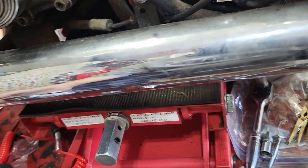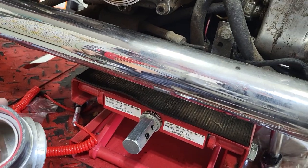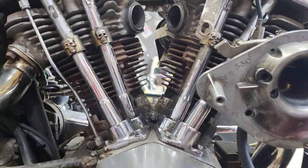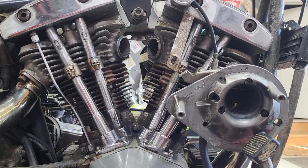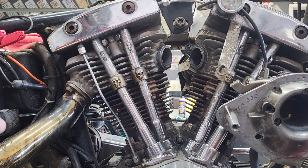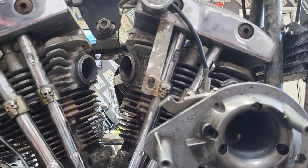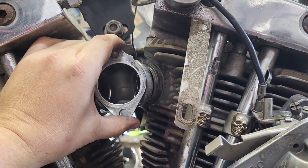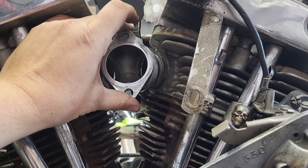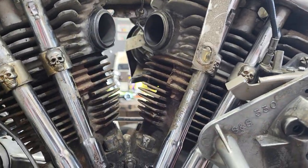This piece is off an o-ring replacement kit you can get from TC Brothers, but I've never had luck with them so it's just sitting in my junk cabinet. It really is that easy — intake seals are real common, they go bad, they dry out. Somebody replaced your head gaskets back in 1984, didn't clock the heads, and you've got a big gap like this one here. If I was doing this right I'd pull both heads off, put new genuine James gaskets on with a fire ring, and clock the heads — put them down hand tight, and everything would seat perfectly. But we've got this big gap, so we'll make it work.